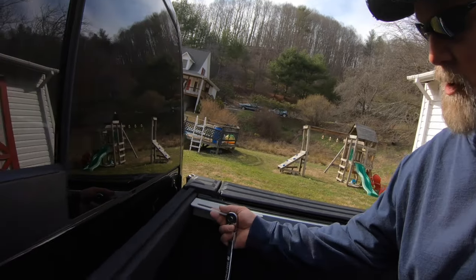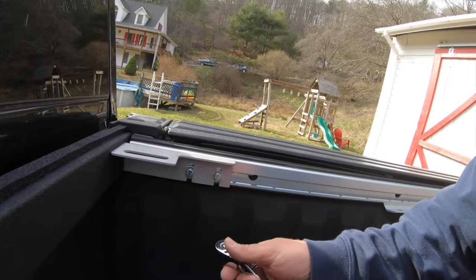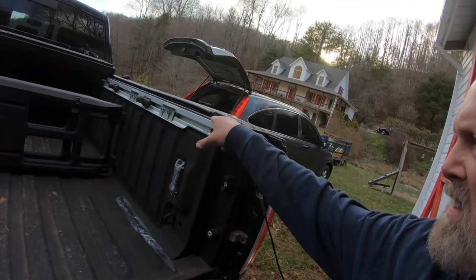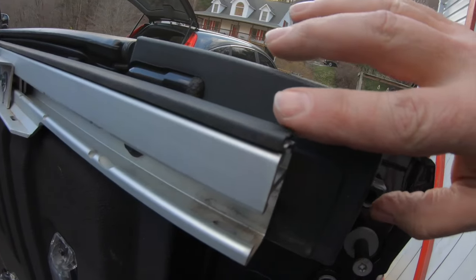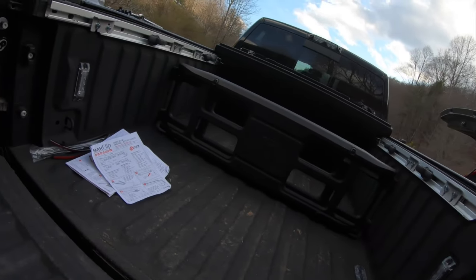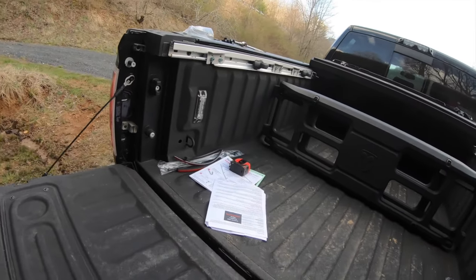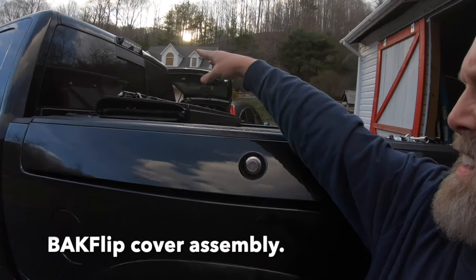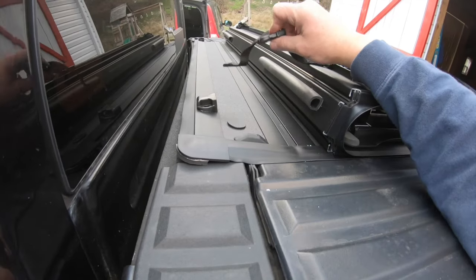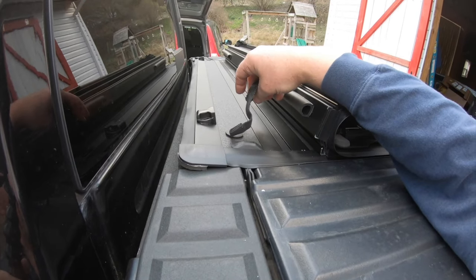We're starting to make some progress. We've got the rear mounting plate and the mounting bracket. We'll take our half-inch socket and tighten those down, getting it even with the top of the rail. We've got the seal on the rail with a small bump on the inside edge running the full length. All brackets are installed with tie-down hooks in between. I've now put the backflip cover on the bed — slide it all the way forward. You've got buckles and mounting hardware; just push the two screws through, tighten with a Phillips screwdriver, and when you fold it down the buckles keep it from blowing in the wind.